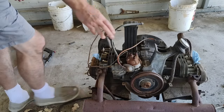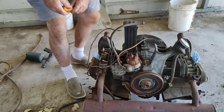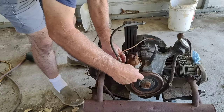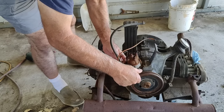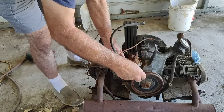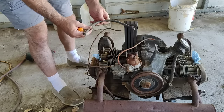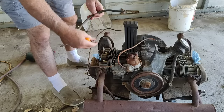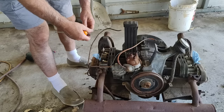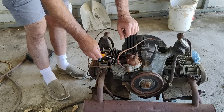I'm going to remove this quarter-inch fuel hose — that's a no-no. You've got to use five-millimeter Continental hose. It's all I ever use; make sure it's Continental — there are other brands out there that just aren't good. These things here are a fire hazard to me. People tell me I have a fire hazard when I have a fuel filter there, but I've never had a problem from that. I have had that hose catch fire, though. So I've got it clean.